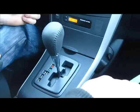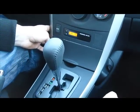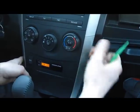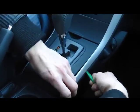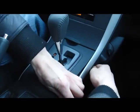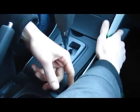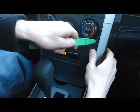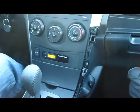We'll start by removing the silver trim pieces. On the passenger side, it's better to open the glove box because it's kind of in the way. Start at the bottom and just pry it off — it's held on clips. There's one clip here, one at the beginning, and one right here. Just use the panel tool and it comes off. You can see the clips there. Put that to the side.